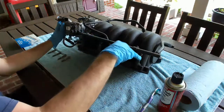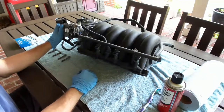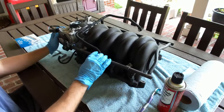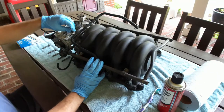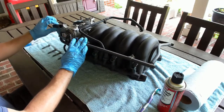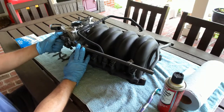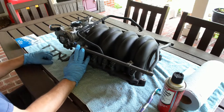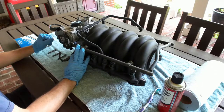Obviously, you have to take off the injector electronic clips here. Those are kind of tricky. Again, there are some hoses here for the fuel lines and such. Basically, once you go around, I just methodically go through here and unclip all the electronics very carefully. Sometimes it takes a long time. That's the most difficult or mind-numbing part, just making sure you don't break things. Take it real, super slow.